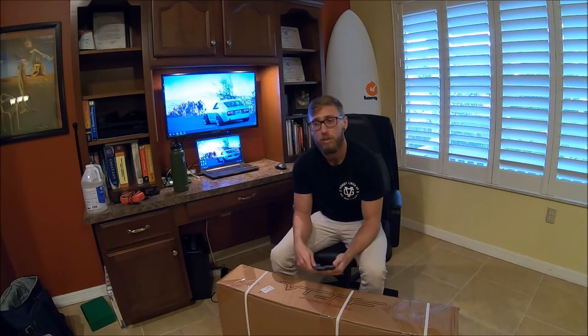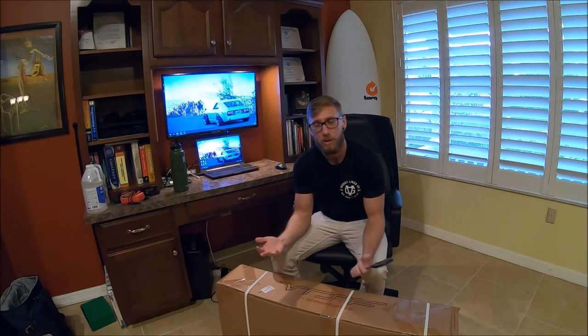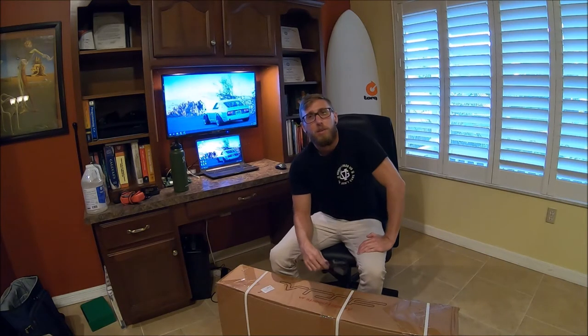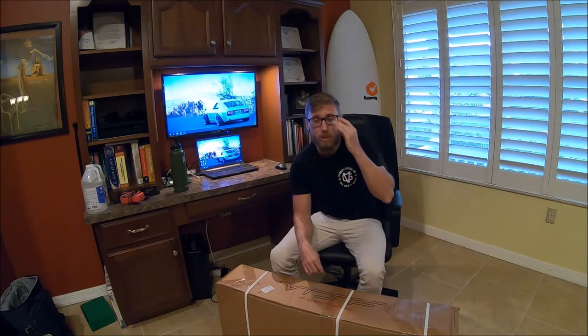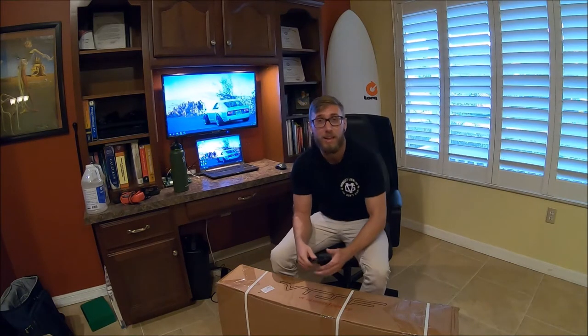One of the things I decided to do was get full valve control with the flap. I wanted to be able to make it quiet when I wanted to, and open it up on command. I saw some people would mod it so they'd always be open all the time, but I didn't think that was a good solution for me. So what I did was go with the JB4, which with the different maps gave me some good horsepower gains and opened up that exhaust flap for a much better sound. Paired with that I went with catless downpipes.